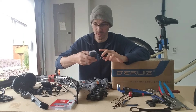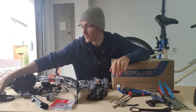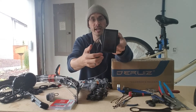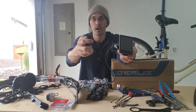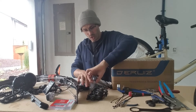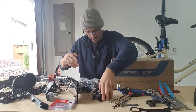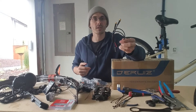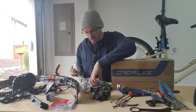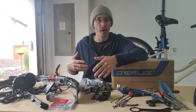This kit is awesome because it came with a cool little front light, so we're going to play around with that and see if we can get it going for her. The kit also has some extra wiring and other components. It's got the LCD screen, which we'll check out later, and your thumb controls — up and down for your settings, your info, and your on and off button. It also came with crank arms, so you will have to remove your pedals or get new pedals for your Bafang kit. It came with these two wires for the brake cutoff sensors, which I'll need to install, and then some other wiring to determine the speed so that the motor, the display, and the bike all talk to each other.